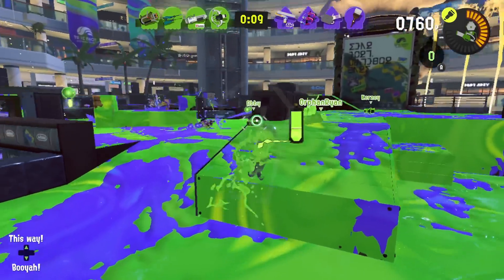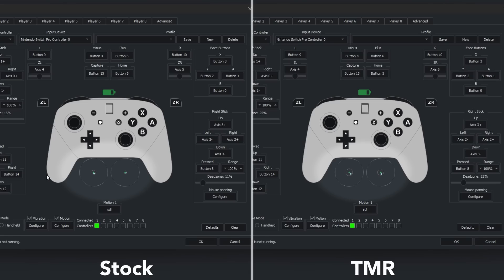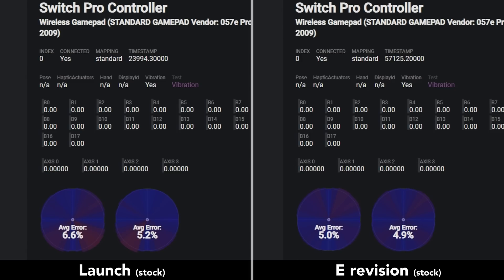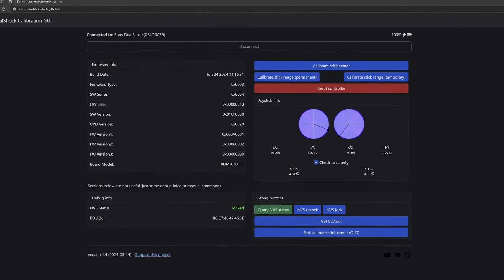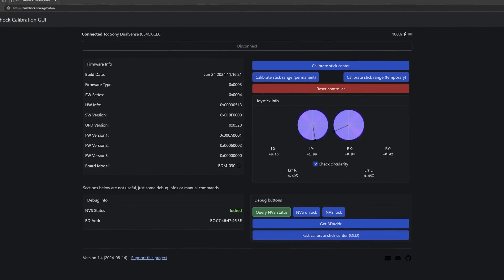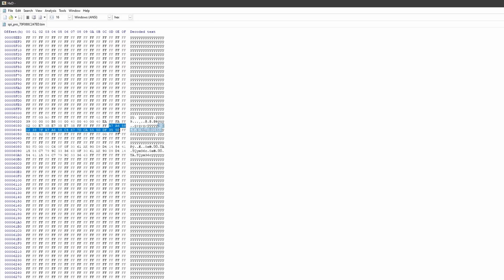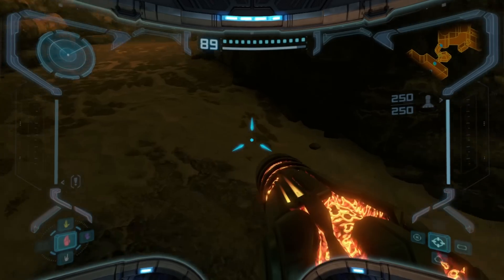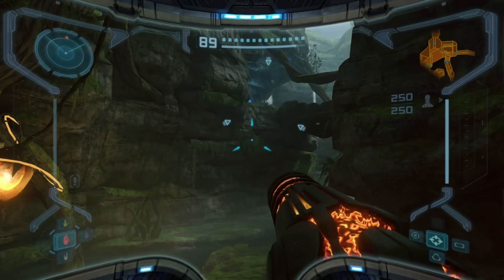The fact that they are a tad smoother and may extend battery life is just a bonus. PC is a different story. I tested with every program I had, even some N64 utilities. The originals had error rates around 5-6% on the gamepad test wrap; the final calibrated TMR results were slightly better in the 4% range, but getting there wasn't easy. The DualSense has good tools that should make it simple to get the sticks fully calibrated. The Switch Pro can't do the same directly — it stores two sets of calibration data: the one done at the factory and the user-created set. The user calibration gets priority on Switch, but a PC will only read the factory data, which is no longer applicable.